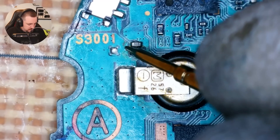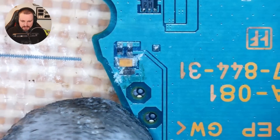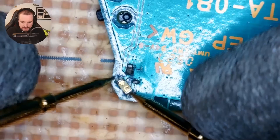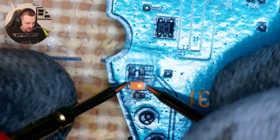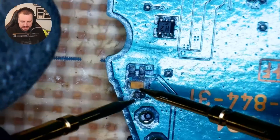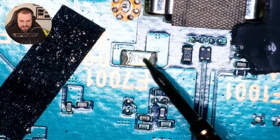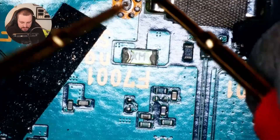This cap here — what do I have? A good diode reading, 0.6 in diode mode. Now we have the issue of this little LED here. If we put it in diode mode with the correct polarity, it should light up, but it doesn't look like this one is wanting to light up. The other one — there we go, we get 1.8 volts. So this LED is actually okay, and surprisingly it might be this one that isn't. Let's test this fuse — continuity mode. That fuse also seems to be A-okay.